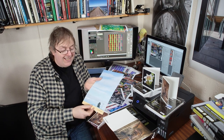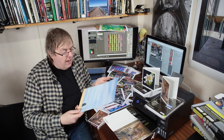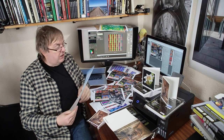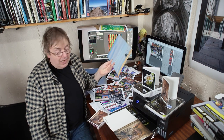Here is a borderless print done on A4 — this is Permajet Artist Watercolour 250. It's very heavily textured, a matte art paper, 250 grams but really quite thick because it's not a very dense paper. In the rear feeder, it doesn't feed well — it will draw in and then you'll get a paper error. However, you just put your finger on top of it, push it slightly, and it'll get drawn through and print perfectly well. This is about the limit of what this printer will take. You certainly couldn't stack a pile of these.